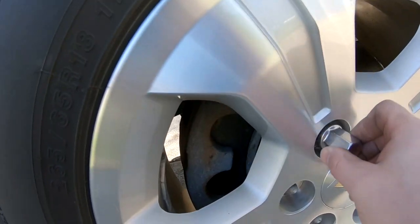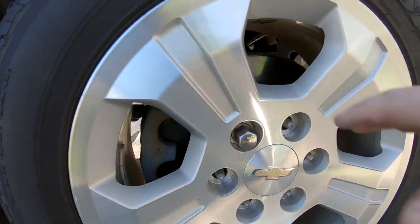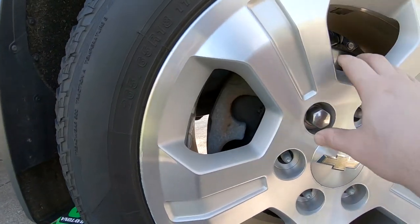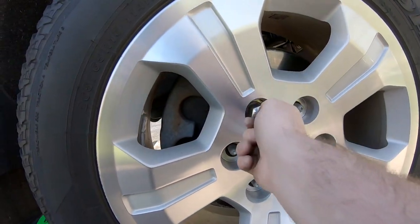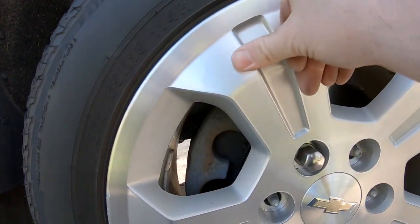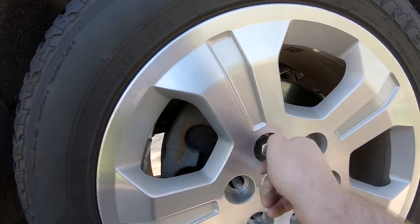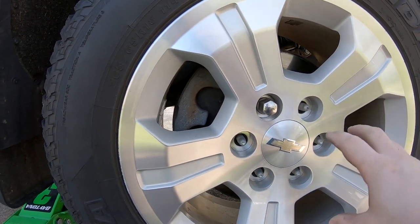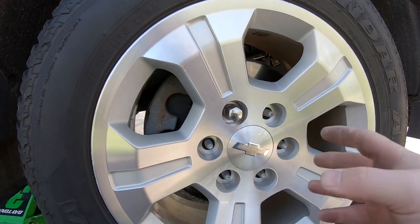So I was saying, you just get your lugs, spin them on. See how the tire just sits under all loose. That's why, once you get them snugged up, you wanna go in that star pattern so that they all tighten and then seat the wheel against the hub in a proper fashion. So you just hand tighten them. Get that all done, and then I crank them in the star pattern with the bar just a little bit, not the torque spec. We'll do that once the car is on the ground at the end.